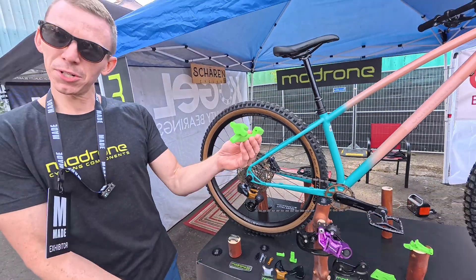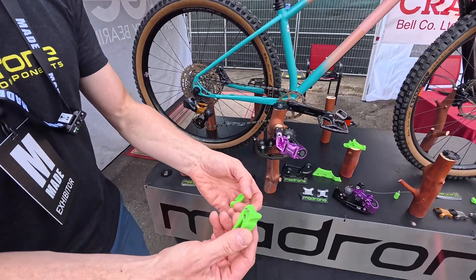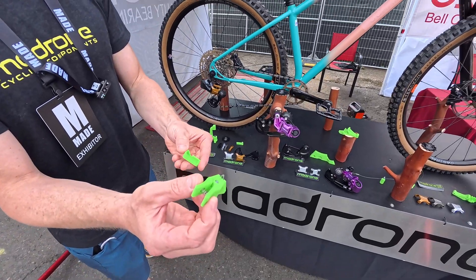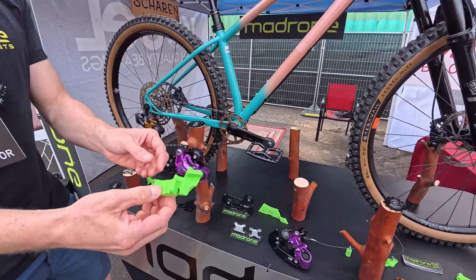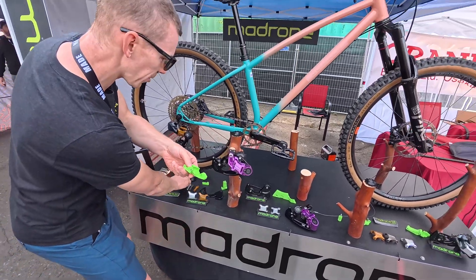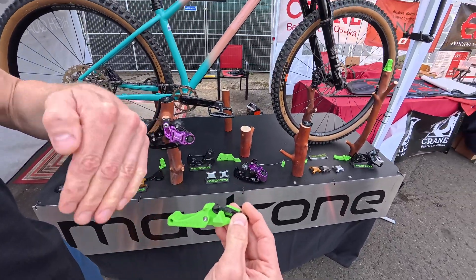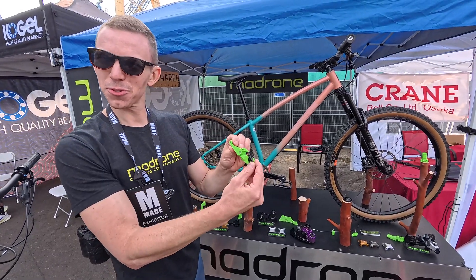We also make a small — this is kind of a fun — snap ring tool for those tiny little snap rings. There are little hooks on the end of these prongs that grip the snap rings nicely. And then another tool that comes in very handy is the spring clamp. You clamp the torsion spring in there and wind up the preload as you install the lower link. So this little tool is like a pliers and a fixture all in one for when you're rebuilding. It's easy to get the spring out, but it's nearly impossible to put it back in unless you have one of these tools.